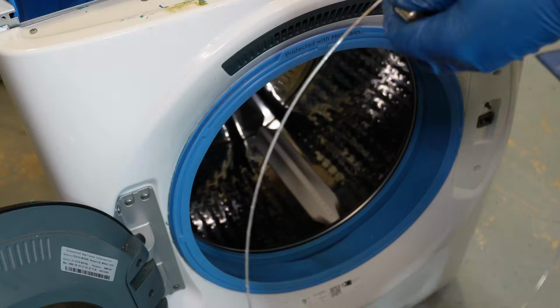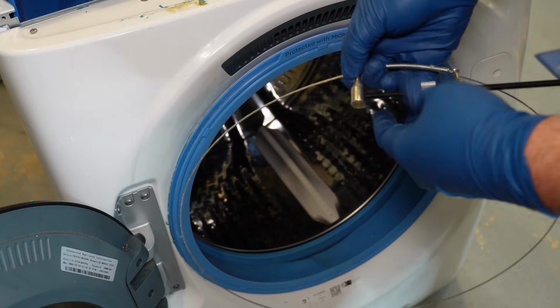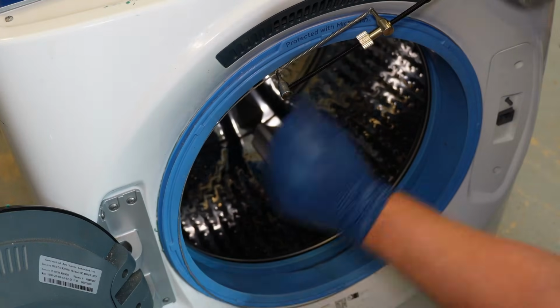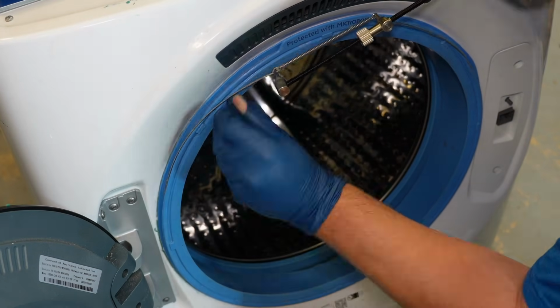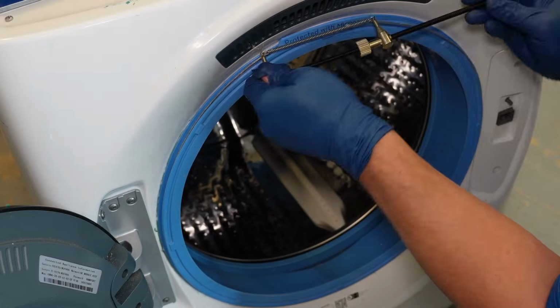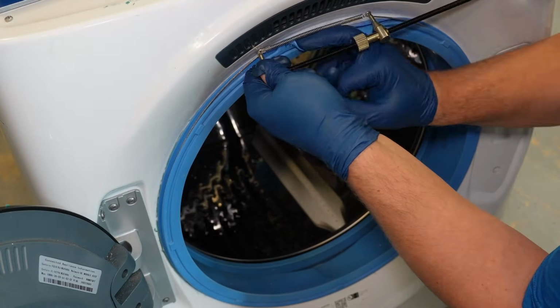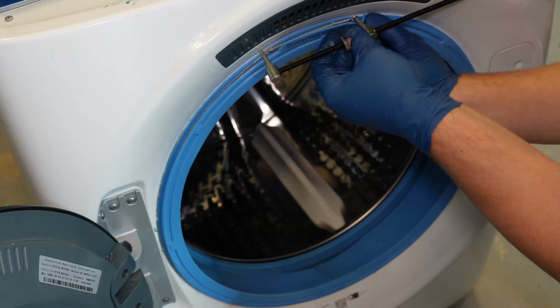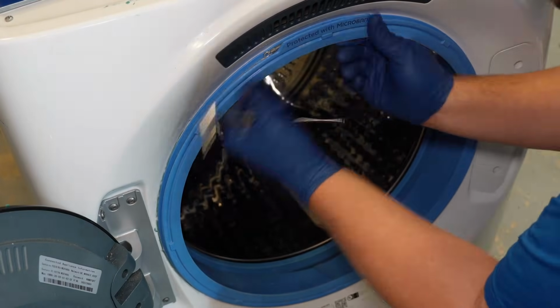The door boot spring is next. These GE units have a much wider spring than other brands, so typical spring tools don't work. I have a video where I used cable ties and a wrench to solve this. I'm using a different tool here that actually works really, really well, and I will have a link to it in the description. Carefully place it back into the seam of the gasket like you see here.